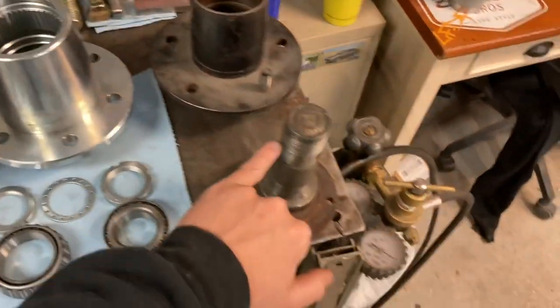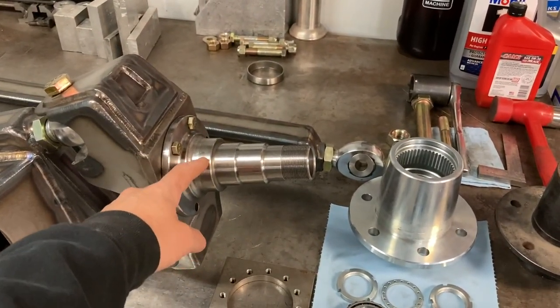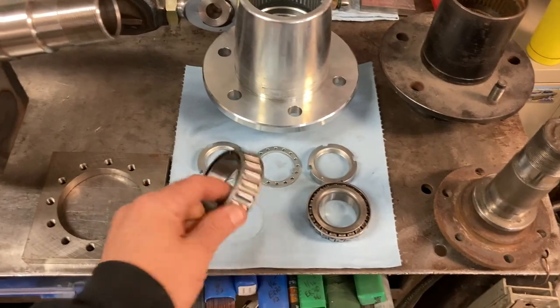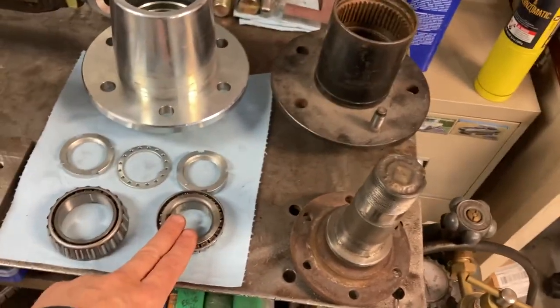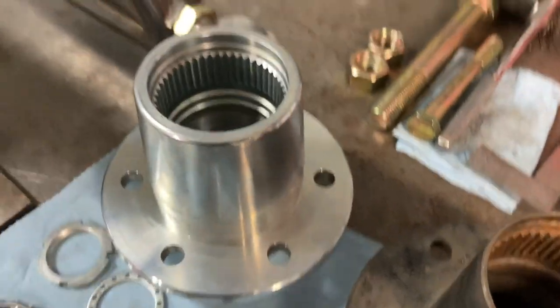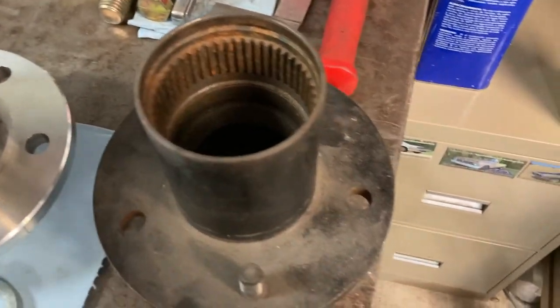The bearings, this is an 1¾-inch Dana 44. You can get online and do your research on all sorts of different years to look for. But the nice thing with this company is they just made it easy. They just make the Ford big bearing option. So this is Ford's OEM big bearing snout. It uses the Timken 2-inch inner diameter bearing, where the one on my C10 uses 1¾-inch. So you get a little bit bigger bearing. The outer bearing is still the same size. And the hub itself, as far as the machining on it, is a brand new machined hub, a lot thicker. You can see they've beefed this thing up quite a bit. They added a little bit of shape to it, a little taper on that. And yeah, looks really nice.